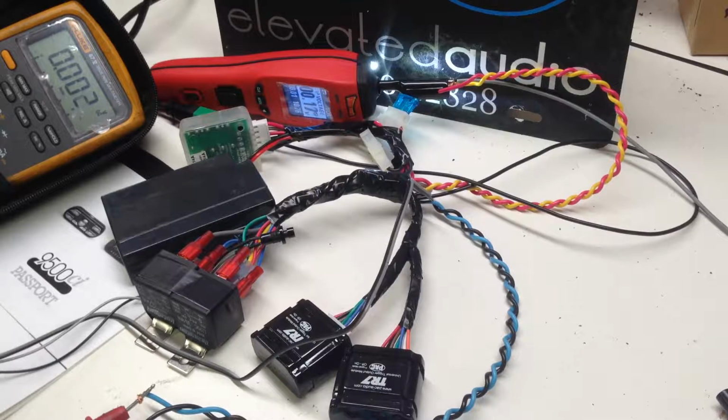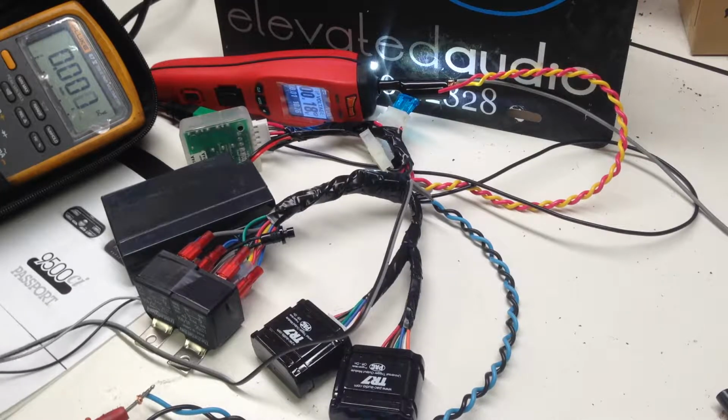It's an optional thing. You could turn this on or off on the dash, but whenever you approach a stop sign or a stop light, hit the brake, it shuts down the motor. Upon the engine starting back up, sometimes there's a voltage drop, and the voltage drop gives you a check receiver wiring error on the 9500ci, I've found. It's not enough to turn off the 9500, but it's enough to confuse it for a split second, and that's when you have that check receiver wiring.